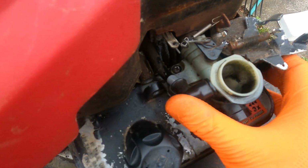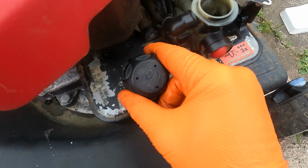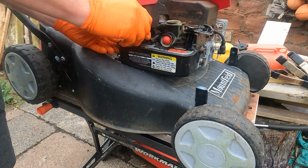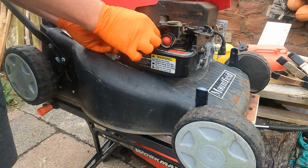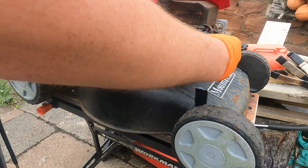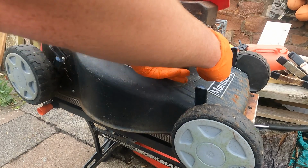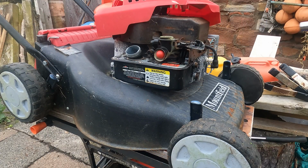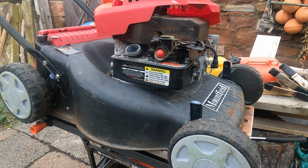The carburetor pushes onto the intake manifold, you've got the crankcase breather there going on. It sort of all just pushes on as one piece. Align the bolt holes here and here. The main one, say remove the fuel cap, bit of clearance, just start that off. And we've got the 10mm on the side. And we'll nip them down with the socket. Just nip these down. Here's the 10mm, and then the 13mm.